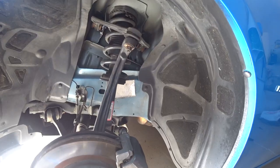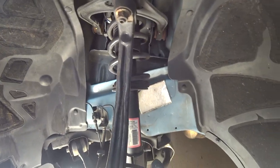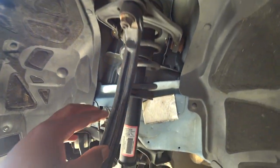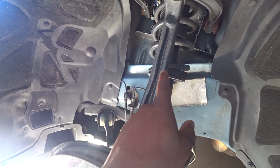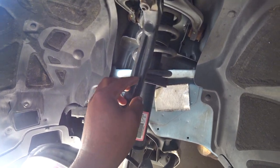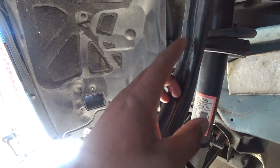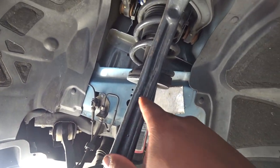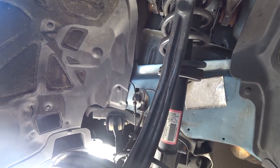All right, so got the wheel off now, and this is the spindle extension. If you look from here, it looks pretty much factory, but I think what they did is cut it in half, right in here. Cut this in half and separate the two pieces, add an extension piece back in there, and then weld the two halves back, and then you have effectively a 2-inch spindle extension. I literally think it starts here and stops there, so it's not a lot, but that's how mine looks.